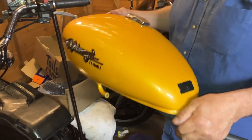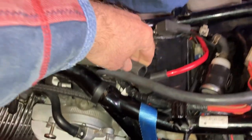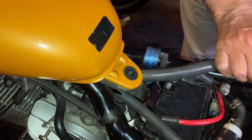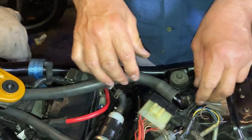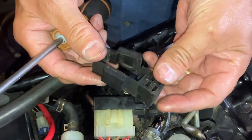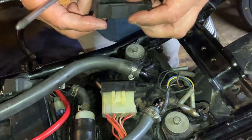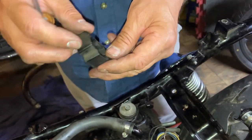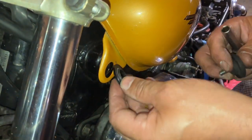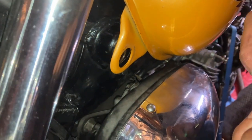We're going to put the tank back on. If you could thread that pipe through there please, feed it through and pull it down — so that's located on there. Just shove the fuel pipe on there — it's all secure. That's tight. Also this rubber for the fuse box holder, we're going to try and get a new one, but for now I'm just going to put a cable tie on it to hold it in place. It's a 1997 so it's knocking on — rubber goes brittle. Don't forget about the collet — the lip needs to be against the frame like that, with the rubber on there.